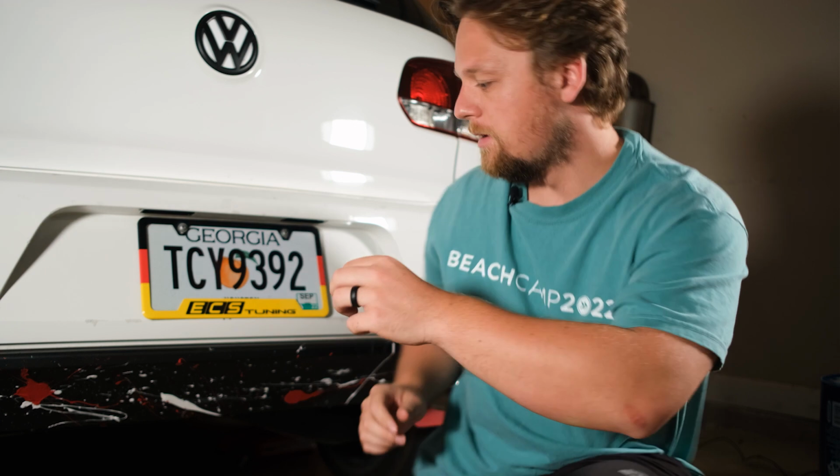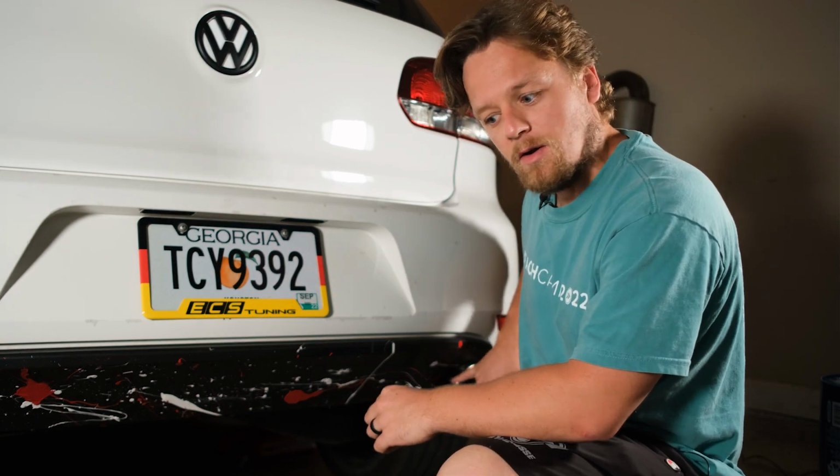All right, so the plan is to take 3 of these washers, maybe 2, depending on how they fit, and put them on each bolt on the rear hanger, right back here. And then we're gonna take the remaining 4, 2 per bolt, and put them by the resonator that's up front. So we're gonna get into that. We're gonna see if this works, if this moves that tip far enough away, moves the exhaust far enough off some of the rear suspension components to stop the rattle.